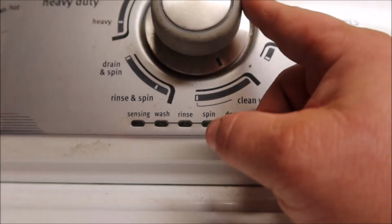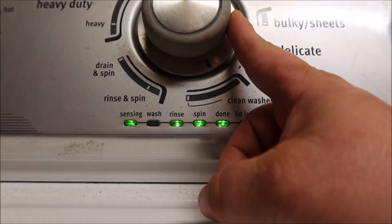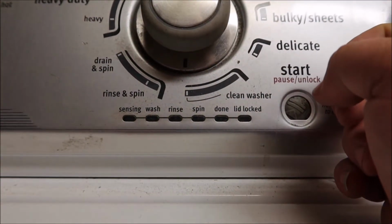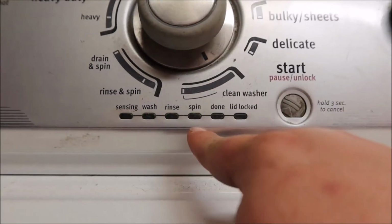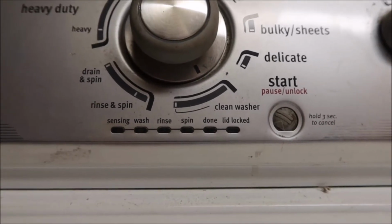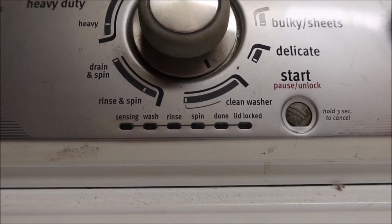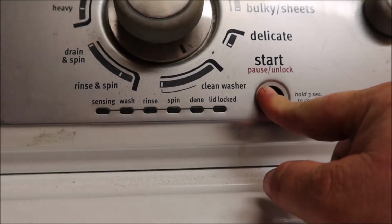You get up to 4 codes stored on this. These are the most recent 4 codes. So the next one is nothing. We've only got the 1 code. This code just so happens to be the speed sensor. So to check and see if that is what's wrong, we're going to exit out.